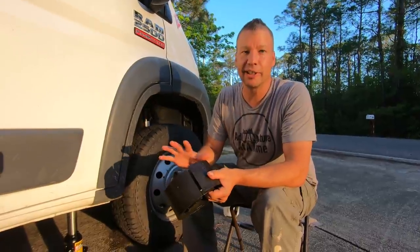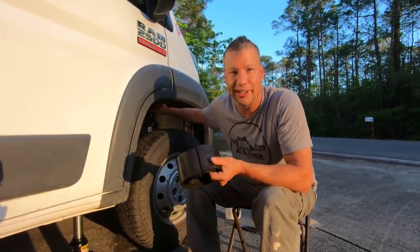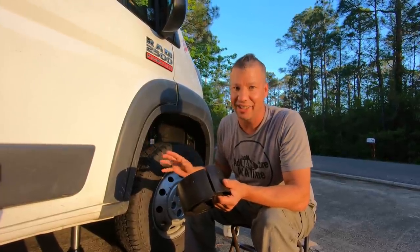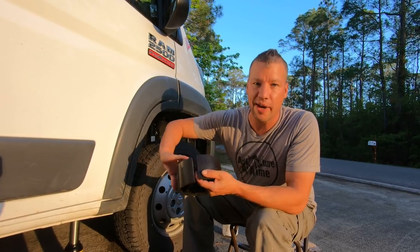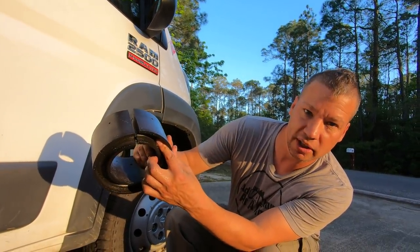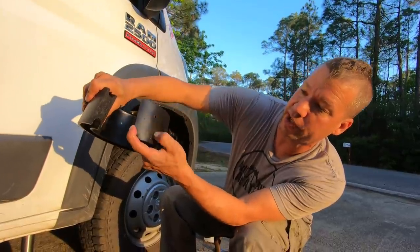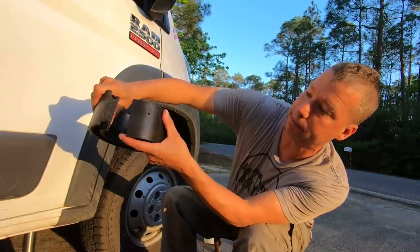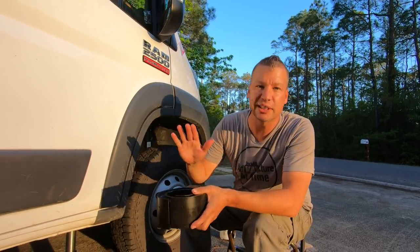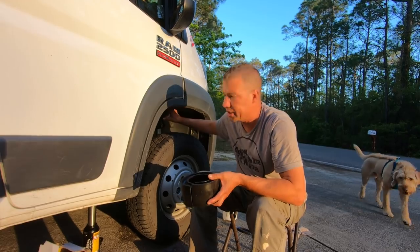What I've learned so far: if you're dealing with a brand new vehicle this is going to be an easy experience because you have new struts, a light vehicle, and a lot of area exposed so you can get your hands in — that really helps. But if you're working with an older vehicle like ours where the front struts are shot, there's not going to be much exposed and it'll be more difficult. What I found that works is spreading the spring out as much as possible. The lower channel is deeper and the higher channel is not as deep, so start with the bottom on the spring, work the bottom on from the edge, then use your thumb to press the top on and work your way around. Definitely spray it down with soapy water, clean it all up, and jack it up off the ground so you have as much area exposed as possible.